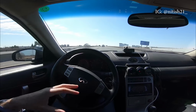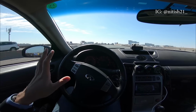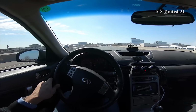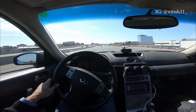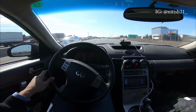So if you're thinking of doing this, honestly, in my opinion, I spent a shit ton of money doing this, and I can tell you it was definitely worth it. This car rips. So I can tell you, go for it. It's friggin' worth it, as long as it runs reliably. So here's the stuff you gotta do. At the very bare minimum, if you want to run a DE past 500-600 horsepower, you're gonna have to get forged internals at the very least.